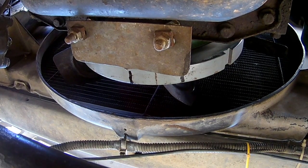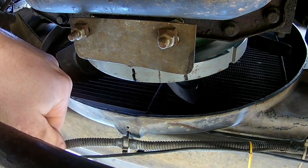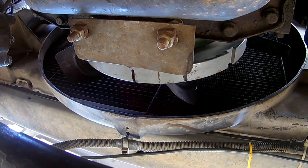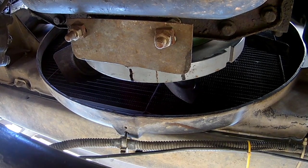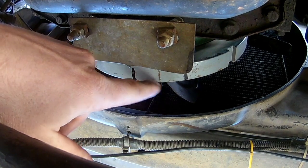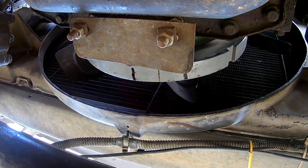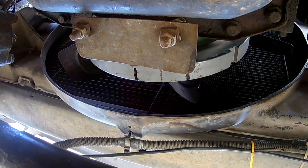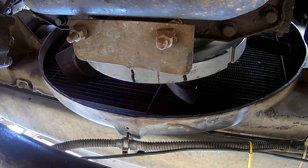You can see that the old mark I made when the cylinder head was off - I had the dial indicator straight on the piston and got really accurate results - it's exactly in the center, confirming this is a very accurate method. It should get you within at least half a degree. When setting timing, the main thing you want is consistency, and that's what this method provides - once you have a mark on the damper, rotate to that mark each time and it will be extremely consistent. When you're done, make sure to set the valve lash on the exhaust valve again, and might as well go around setting them all while you're at it.